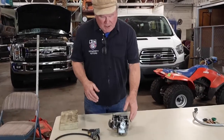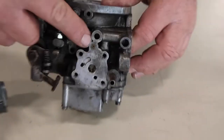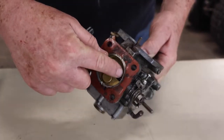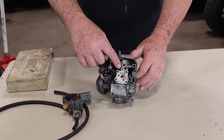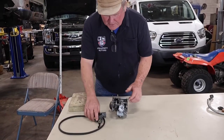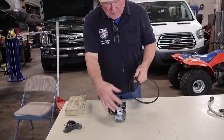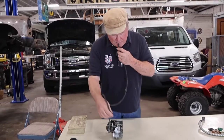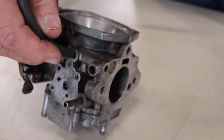When the car is running, there's a vacuum up here at this little tiny brass vent. That vent is routed into the back and there's a hole up above so it catches manifold vacuum. There's always a vacuum there while the car is running. You can take the choke off, start the car up just with the choke dangling there, put this up to your lip and push it on — the question is, is there a vacuum?